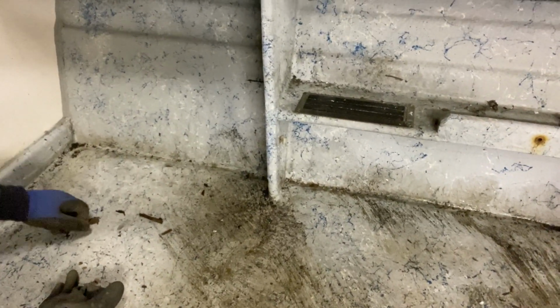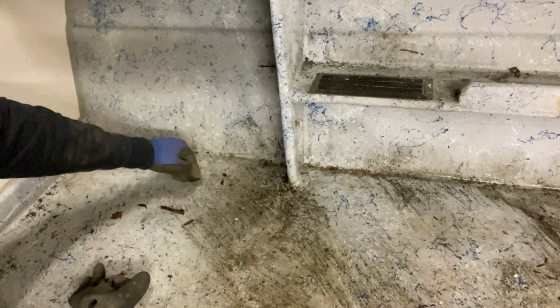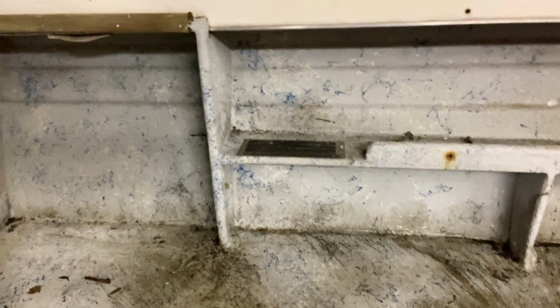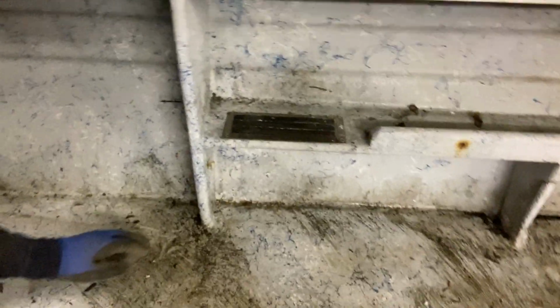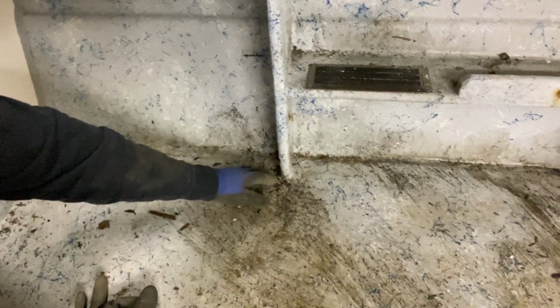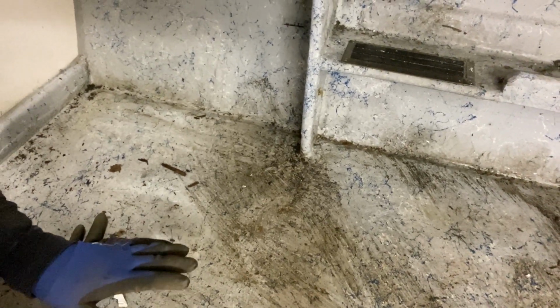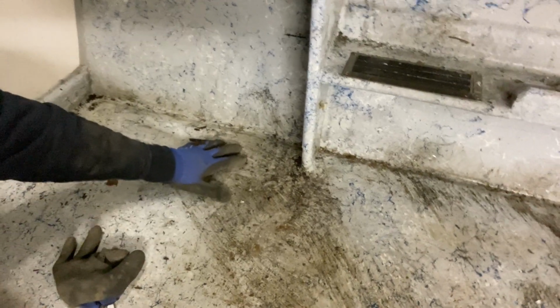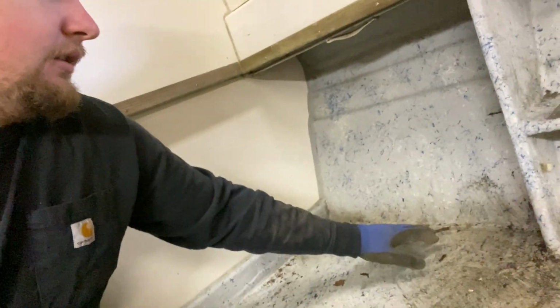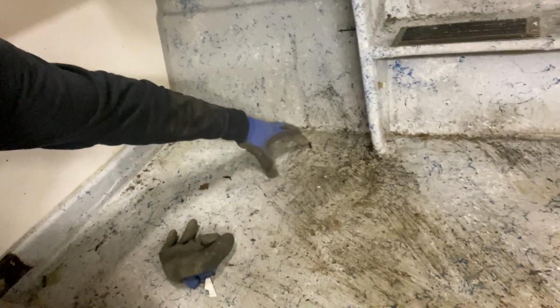But for right now, I'm going to run the skill saw down along here, use the fence, and cut from here down, because if I decided to fiberglass into it, I could always use some polyester thickened resin and fill this in right here and then lay some glass in. When you cut out about 4 inches right here, you can grind this down so you can lay plywood down, make a complete floor, and then make fiberglass probably 1708 across, probably from 24-ounce matting, and then you can inlay it up on the side, do it however you want, but you have something to contact into.